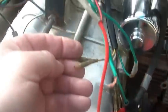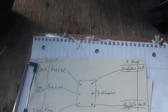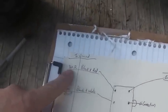For black and red — the coils beneath the stator — this one has three of them: a yellow, a white, and the black and red, which actually powers your CDI unit. You should have about 360 ohms there. If any of those conditions are not met, you are not going to get a spark.